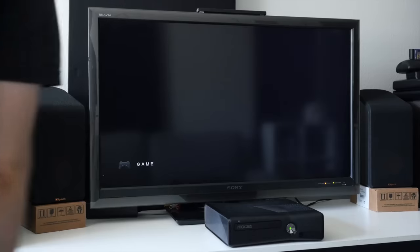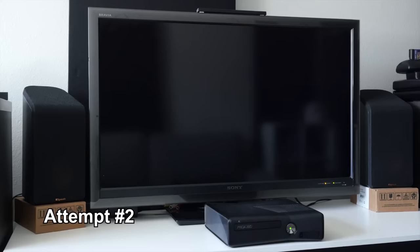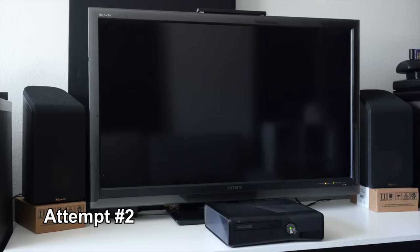This means the reset glitch can and does fail. The console will restart if it does, giving the glitch chip a chance to keep trying indefinitely, but depending on how close you got the timing — and honestly, how lucky you are — it can take several attempts before it hits at just the right time. You can get a system that boots first try most of the time, but there's effectively always a degree of randomness to it. This was simply the reality of RGH modding until last year, when RGH version 3 was discovered and published.